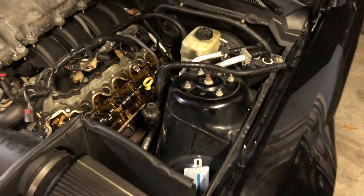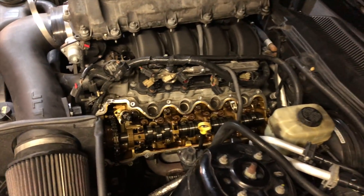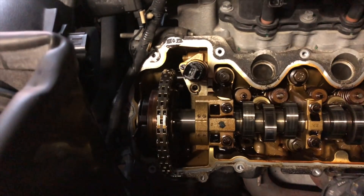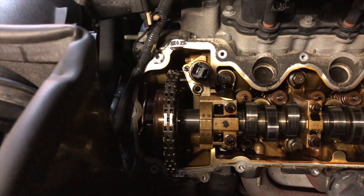Unfortunately, he has the cams — they were put in — but one of these was actually broken a while ago, before he did the cams, so it could have been that. The intake side wasn't even opening, because all of these are just broken, sitting in here. All the metal is going down in there, so even just replacing all the different rollers, there's still metal surfacing all up and around.